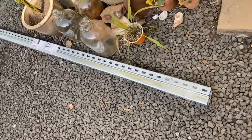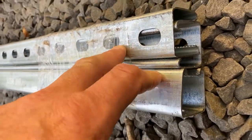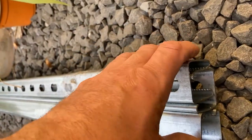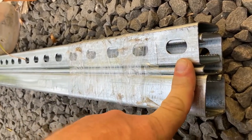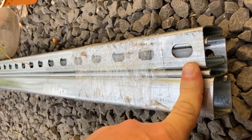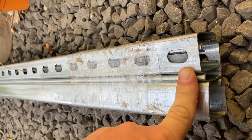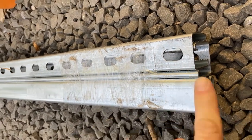Great, so we've got three lengths, truck delivered. This is the light duty stuff — it's just a thinner metal, but it makes a huge difference to the weight. And it's unlikely that using heavy duty is going to give any additional strength, because the limiting factor on a roof rack is always going to be the strength of the roof and the connections to it.